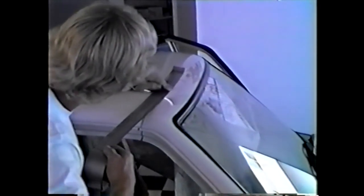Drill three or four holes through your roof to establish your inner cut line. Next, lay down a strip of duct tape on both sides of your cut line to protect the paint during your cutting procedure.